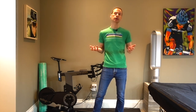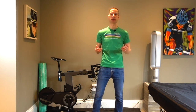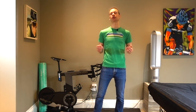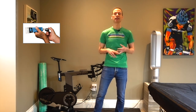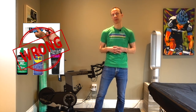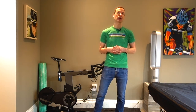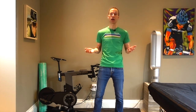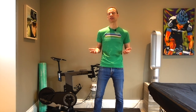Wahoo suggested using poly lube, but essentially any bike-specific multi-purpose grease is going to work. Do use the proper type of grease — don't use assembly compound or anti-seize, don't use chain lube or WD-40, don't use carbon paste. Use a proper multi-purpose synthetic grease and it's going to work just fine. Here are the greases I've used in the past and they all work very well — there are tons on the market and almost any multi-purpose grease is going to work just fine.